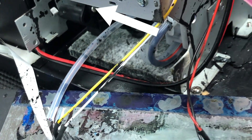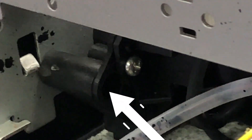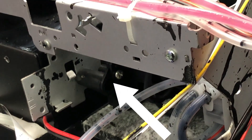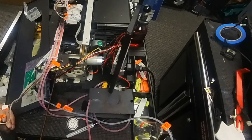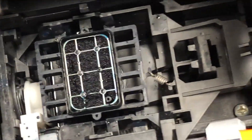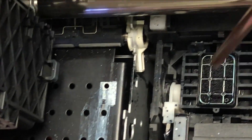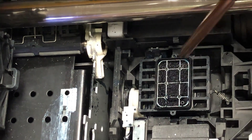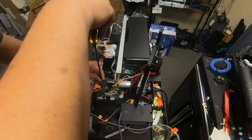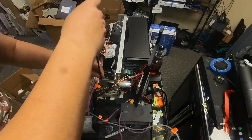The third screw is deep inside that casing — you will not see it from outside. You'll need a long screwdriver to go in and remove the screw. Screw number four is top-down on the top of the capping station. Look how wet it is — because it's clogged, ink is going to suck out of it. We remove screw number four.